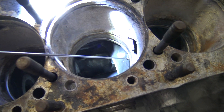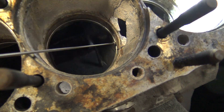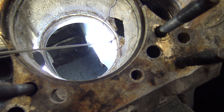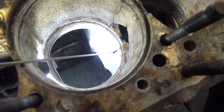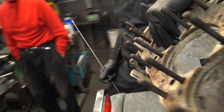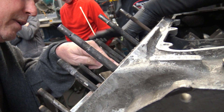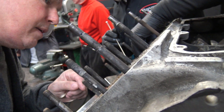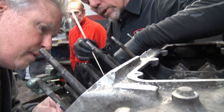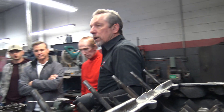The crack, if you look closely, extends down beyond the O-rings — if you follow it, it goes way down to about that mark. When it's hot, that crack went almost all the way down into the main bearing web. It continues down and there's a crack that goes down there — that's where the coolant was bypassing. It just didn't want to seal. A sealer will work on simple stuff, but not here.